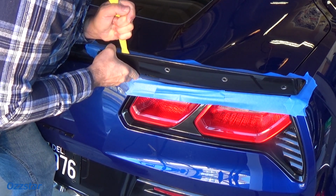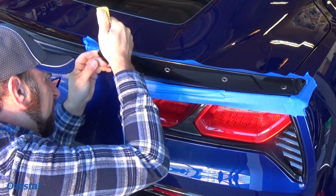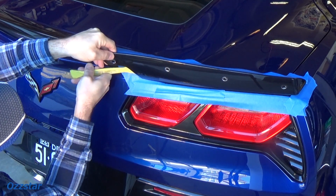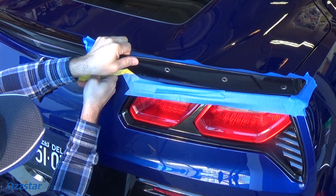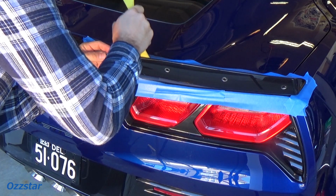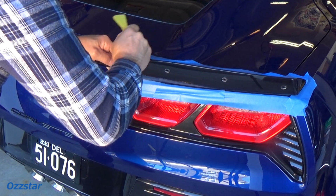And what you can't see is I'm kind of chopping away the two-sided tape. You keep pulling on it. It's kind of scary, but it'll go. You get it in from here, then come in from this angle. See if you can release it there. Just kind of cut that tape away, little by little. And I'm not worried about what's going on behind it, because obviously you won't see that if it gets a little scuffed or scratched. There we go. Just pulling pressure out, and pulling back, while I kind of cut the tape, so to speak. It's foam. That double-sided stuff is kind of like glue, sticky foam.